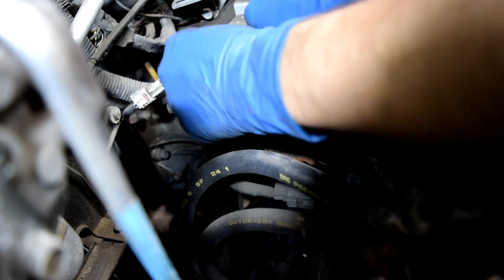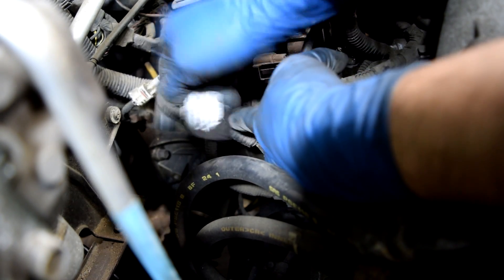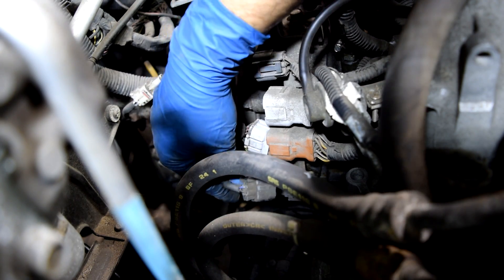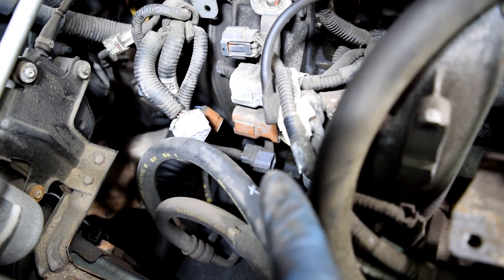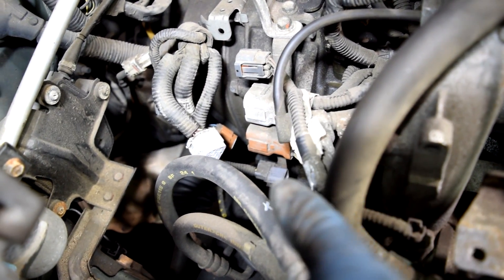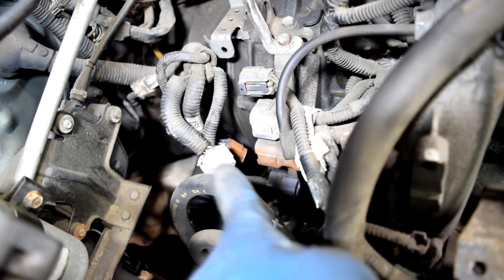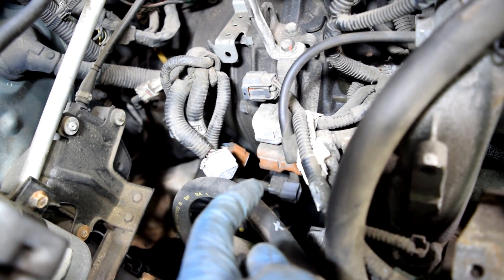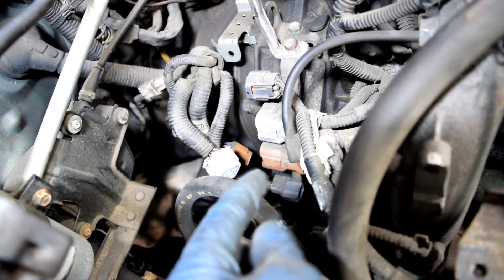That one down there — these should be fairly easy to remove. You just press on these little clips or tabs that are on them and then you pull. They should come out. This bottom one is a little different; the tab is on the other side and you pull the connector towards the engine side. We need to completely remove the connector that's on the harness side from this little bracket where all these connectors are, because this bracket is connected to the engine but that wiring is from the wiring harness on the back of the engine — that's part of the body. So there's going to be a little tab on the other side of that connector that you need to push out and then slide that off this metal bracket where all these connectors are resting on.